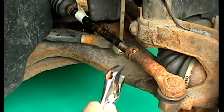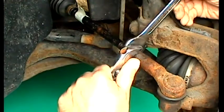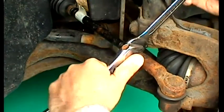After each rod adjustment, retighten the lock nut as specified in the maintenance and repair manual. Again, support the track rod end level while you tighten the lock nut.